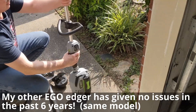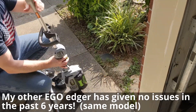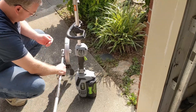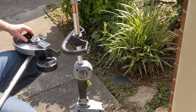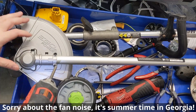Of course it's got no warranty. The power head is in good shape — I even used it on something else — so I believe the problem is in the gearbox side here where the miter gears are. I think I can hear it skip, like the teeth are grinding a little bit, so I'm going to throw it up on this tool cart and take it apart and look at it.